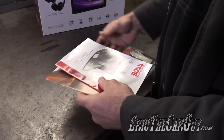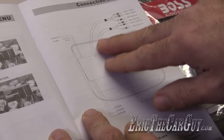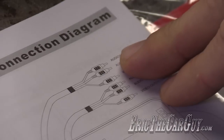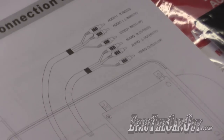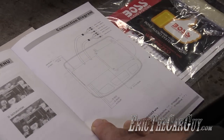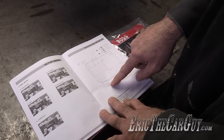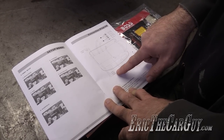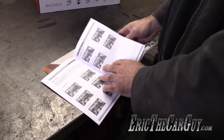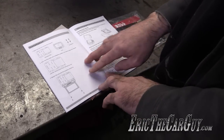Just to give you an idea of what I mentioned about the installation instructions - this is pretty much it as far as the wiring is concerned. You have RCA type hookups that, if you have that type of system, you can run audio into the vehicle's speakers that way. But there's also an FM transmitter so you can just dial in a radio station and listen to it that way. That's the option I'm going to pursue today because I have the stock head unit. I also need to supply it with power and a ground.